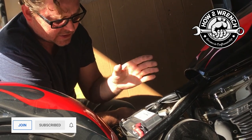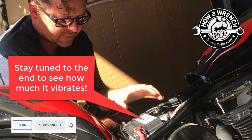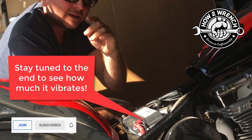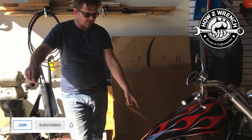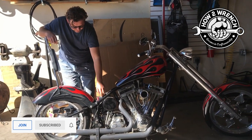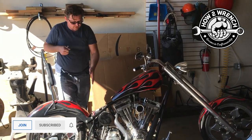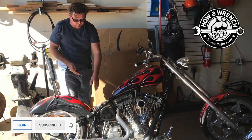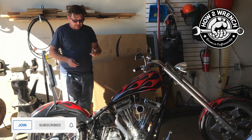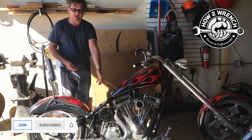I'm noticing I'm not happy with this design — there's no strap on here, and that's something that needs to be fixed. As you're riding down the road, this battery is sitting there banging back and forth, and every time it moves it's going to loosen that cable. Here's a good story: Harley-Davidson, when they came out with the 2006 Dyna — the new twin-cam — they had a recall where the wire routing going back to the bracket for the ECM and tip-over sensor was coming at an angle, and the way that engine vibrated was working the cables loose.